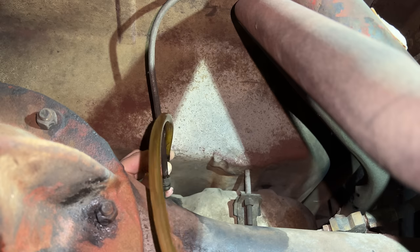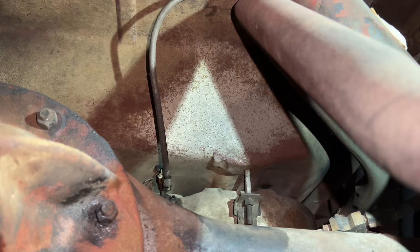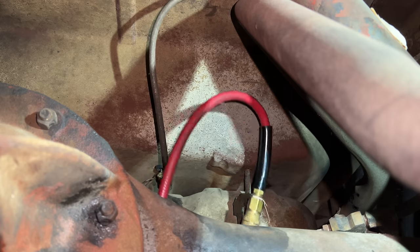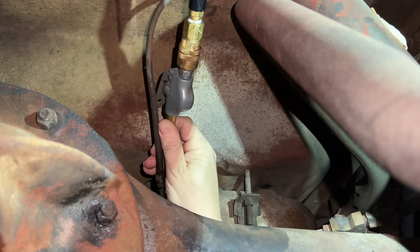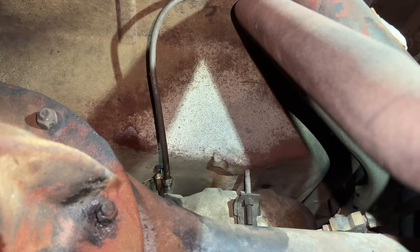There's some starting to come, but not a lot. Let's try to connect it up the other way, see if we get fuel to come back this direction. Fuel's coming back from the pump, so our problem must be here in the tank. I still have the gas cap off — don't try this with the gas cap on your tank, you might explode it — but I'm going to take my air gun and try to blow air into the tank to see if I can get this unclogged. Nope. This line or something in the tank must be pretty clogged up because I cannot blow any air through it.